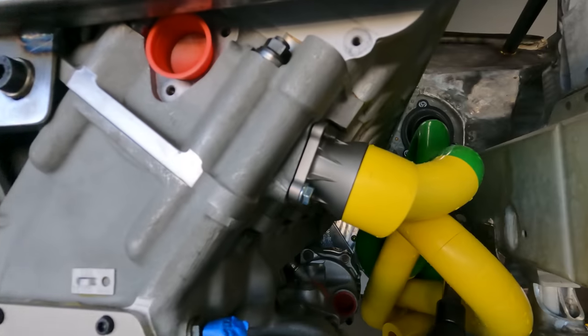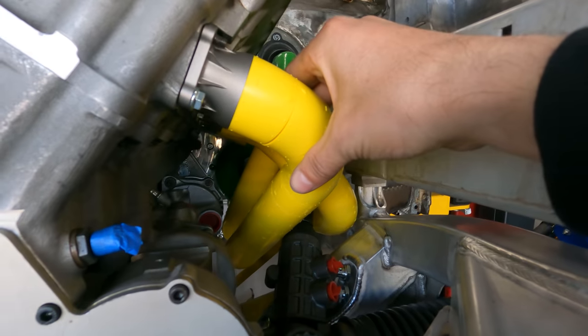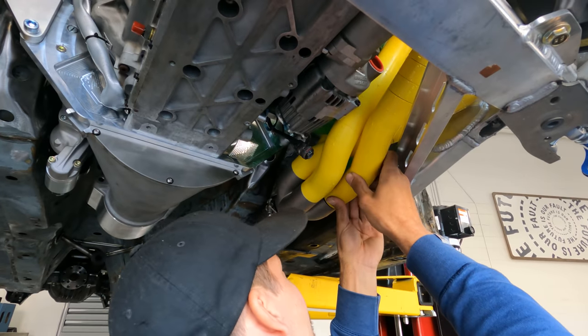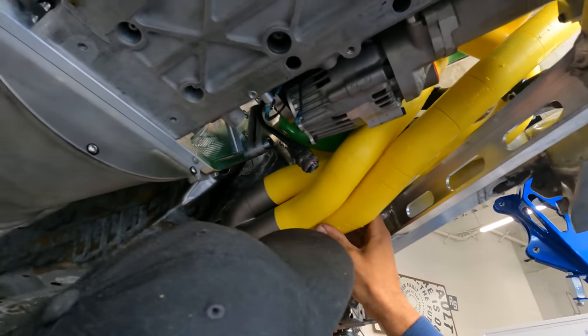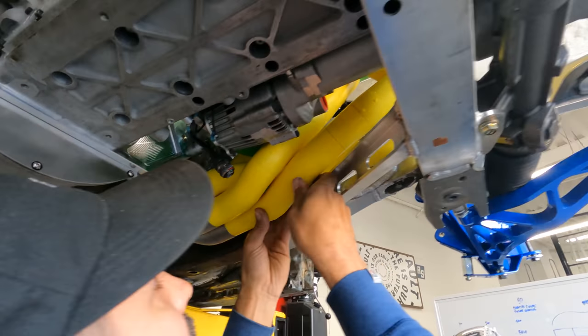One more to go, on the driver's side anyway. The only tough thing on the last one is trying to keep it at that 26 inch length, since this is the furthest one from the collector, so we have to do it as straight as we can. All right, the final one. There it is. Snap. That's it. Touch the line off. It just makes it. Yeah, you're stretching a couple areas for sure. I mean, just barely made the 26 on the furthest one out.